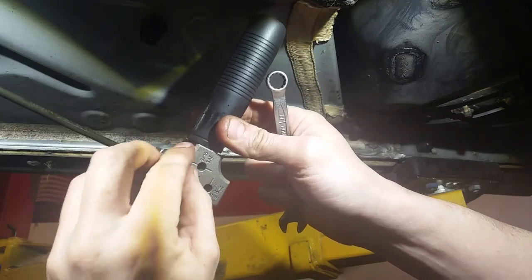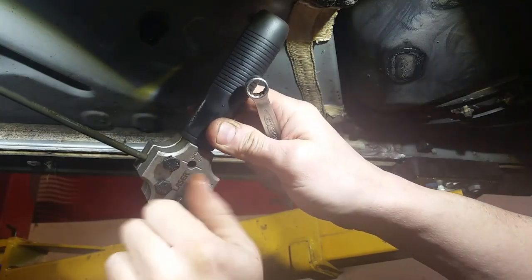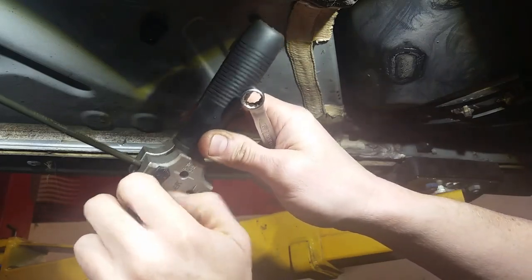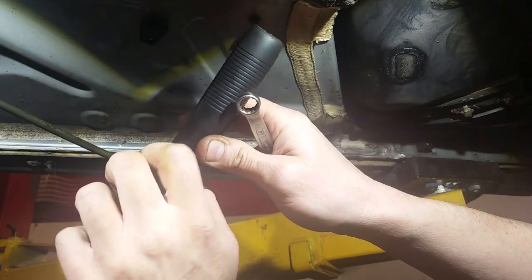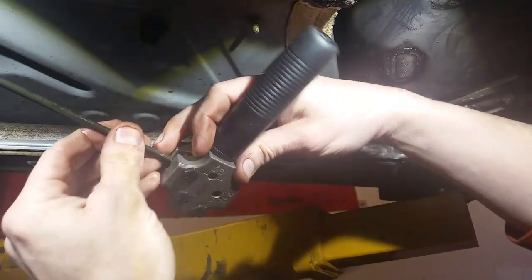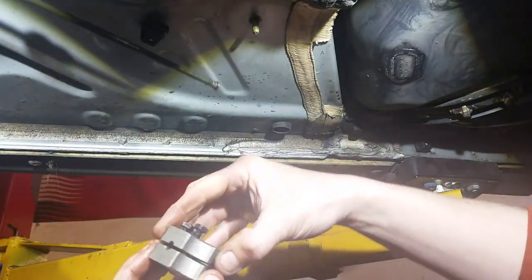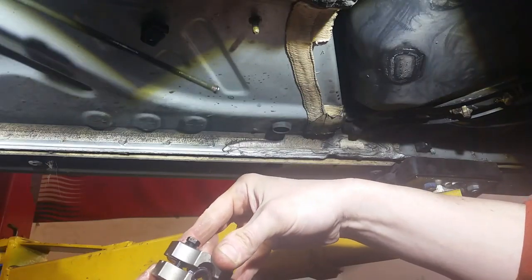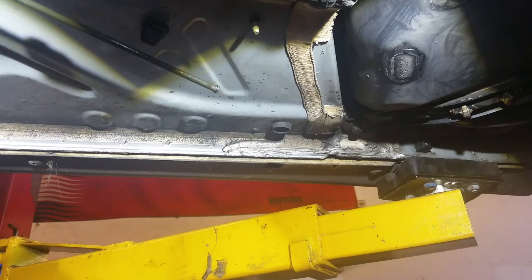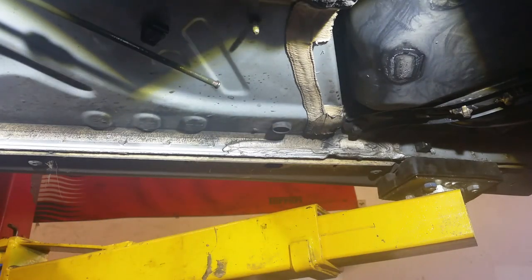Right, a wee bit I don't really like about this wee tool is you near enough have to take it apart to get it off your flare. So it has to loosen up quite a lot, and then we go. We have to more or less split that, and that clicks back together again. Alright, so there we go. There's our wee bubble flare.